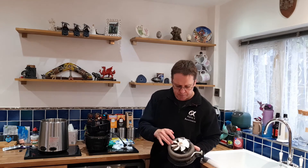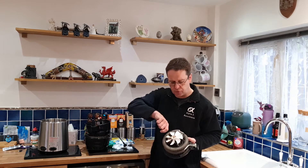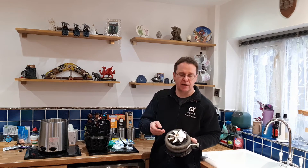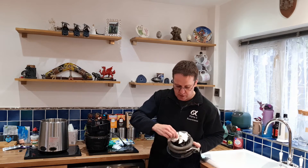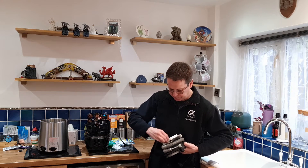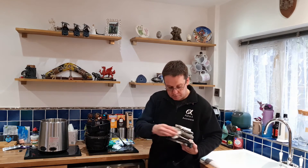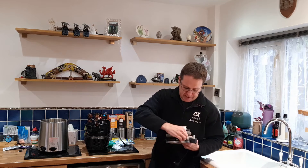Next bit's the fan. That's just got a ring clip. If you get a screwdriver — a flat blade — you can pop that up. It's relatively easy to put back on again. What I tend to do is just wipe all of the blades and try and get underneath them as well, because they can get quite dusty and dirty. Once you've done that, obviously the actual plastic itself, working around there, getting that all clean.